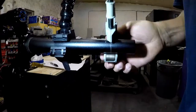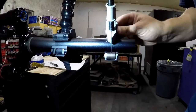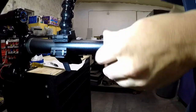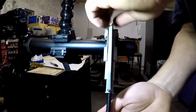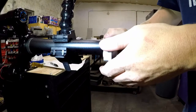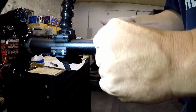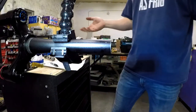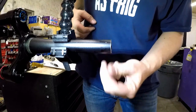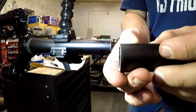We're going to have some work to do with a file after this. Each time, just going around once, I'm going back because of the spiraling issue. I'm tightening the knob a little bit each time and making a cut. It looks like we've gotten rid of our spiraling problem. Easy peasy guys — see, that was no problem at all. Now, it didn't make a very straight cut, so I've got to deal with that. I may not have the 10mm I originally wanted.